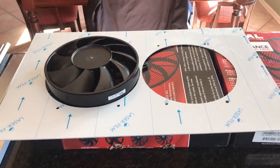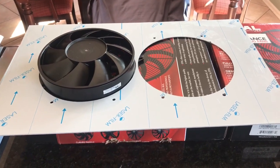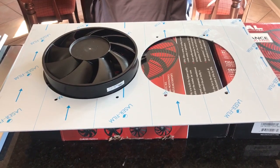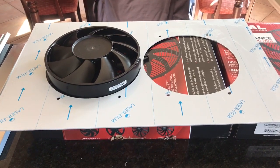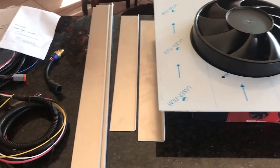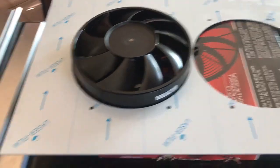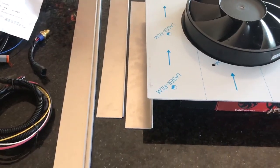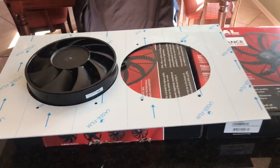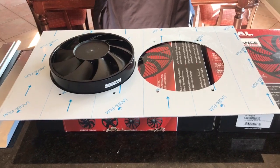It's a neat setup, and there are a number of reasons why I purchased this. Number one, I needed to build a custom shroud anyway. It's nice that wizardcooling provides these parts — they provide the pre-cut face so I don't have to deal with that, and they provide the side panels. Essentially I'll cut this up to the right dimensions, attach the side panels with a couple of rivets, and then send it to the welder to weld it up.